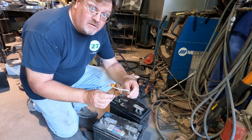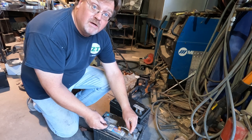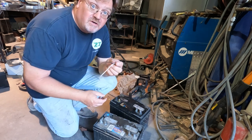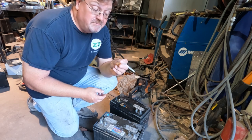Now if you hook it up like a house, with the white being ground and the black being hot, there we go, we got a light. So keep that in mind. If you ever run across the white and black set, usually black is hot and white is ground.